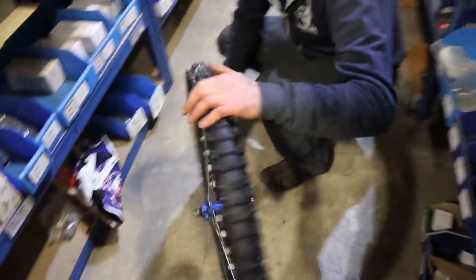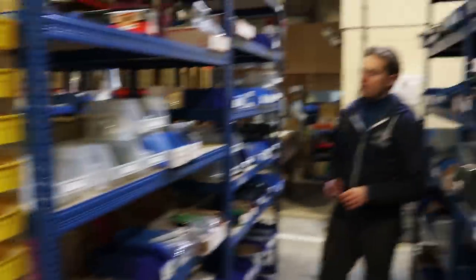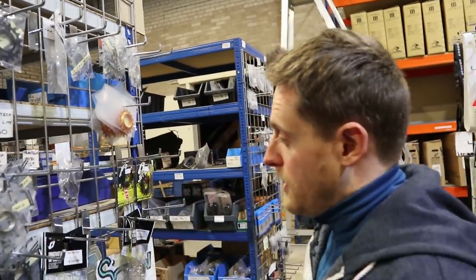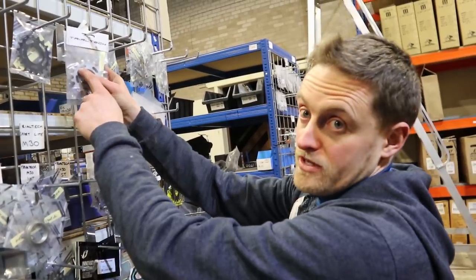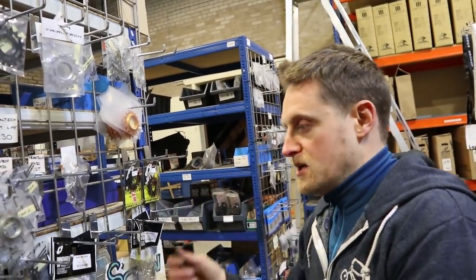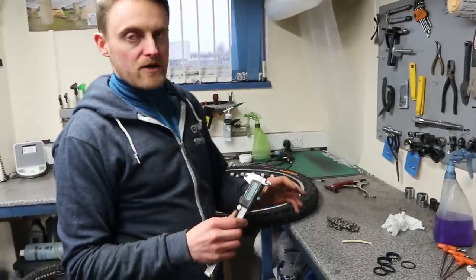This hub is a Shimano spline, but you've also got screw-on ones. A lot of trials hubs use a screw thread, a bit like a fixie or track cog, but they often run a wider base — like 10mm wide — so there are 10 threads of contact between the hub and the sprocket. Watch out if you buy a fixie or track cog off eBay, as they can be a slightly different thread size — 1.37 inch versus 1.375 inch, which is a slightly bigger diameter and won't fit properly. They also have a narrower base of six or seven mil, so there's less thread contact, and if you're stomping the pedals hard on a trials bike you'll wreck the hub. It's worth checking the spec of any sprocket you buy to make sure it's up for trials use.